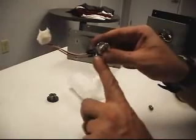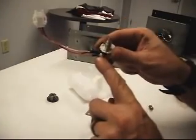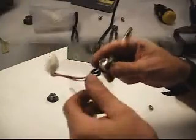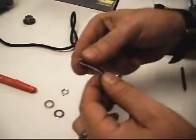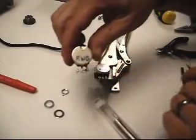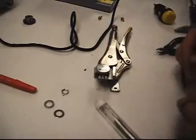Shouldn't be much. I'm cutting the heat shrink tubing off. Going to get these cleared out, bring my soldering iron in here, and I'll probably heat those up and just pull each terminal off individually. I have the digital soldering station all hooked up and heated up. I already disconnected the other one, and I made sure to label my old one so I wouldn't lose track of which wires went where, and I just transferred the labels down to the new one.